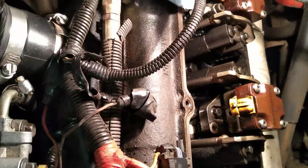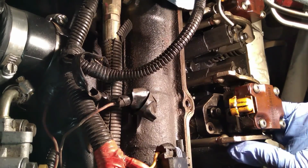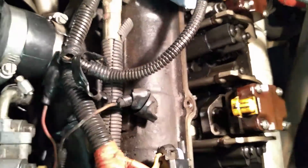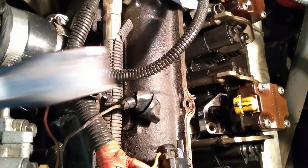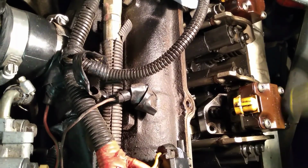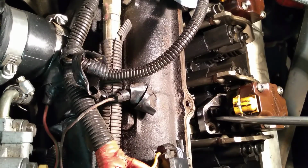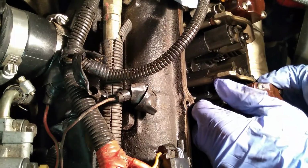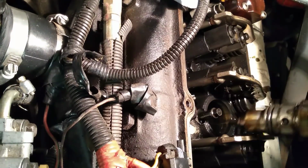So just so you guys can see, there is in fact another bolt up top here. And this is why it's so important that you slide the clamp up enough to clear the bolt, so that otherwise you're not trying to rip out a bolt as well. Well, I mean, it's super easy. It just came right up. Alright, now it's a little stuck. It's a clamp. Lift it up. And pull the injector the rest of the way out. Ooh, just like that. Interesting.